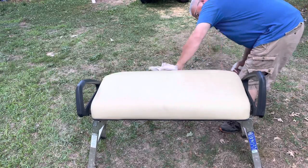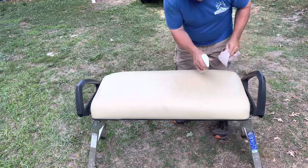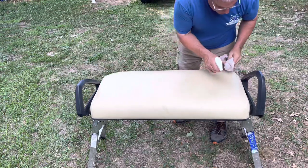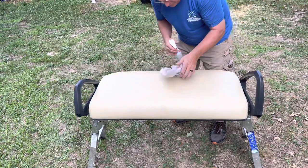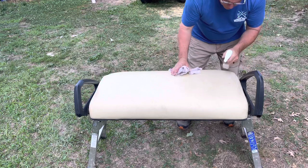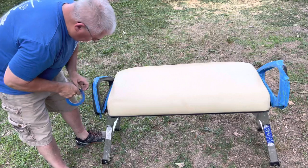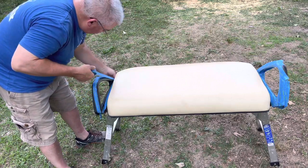To prepare the surface for the color, you need to start by removing all grease and wax with a wax and grease remover. I used alcohol, the same stuff you get in your medicine cabinet. I sprayed it on, wiped it off, made sure everything was good and clean. If you do not clean it well, you may have fish eyes where the color does not stay or adhere onto the seat. Also cover up anything you don't want sprayed — I used regular painters tape for these handles and it worked great.